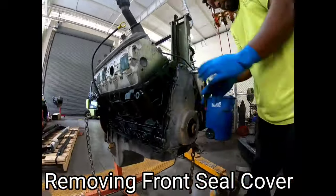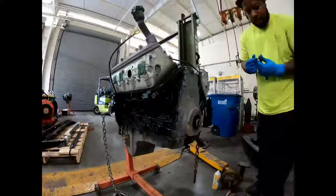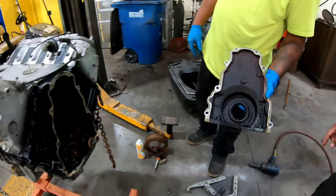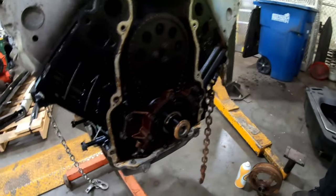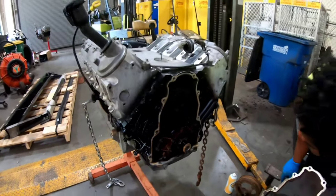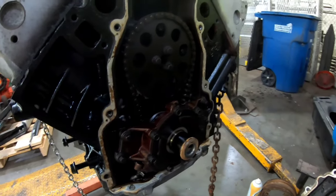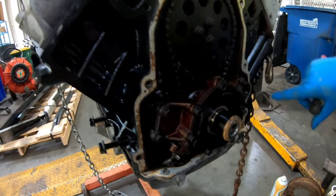To remove this cover, there are eight bolts on the front and two on the bottom through the oil pan - all 10 millimeter. You got about a double timing chain. A double timing chain? He don't need all that - not for a stock rebuild. He got a regular timing chain, OEM, AC Delco. This is the oil pump right here. You got to take that off.